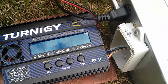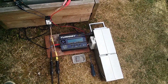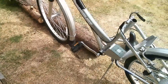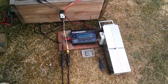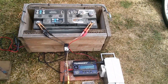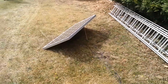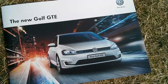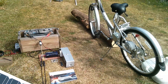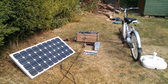So it's not quite as convenient to set up as it used to be, where you just had a mains charger pack that you plugged in and just charged it up easily. But this is now a genuinely solar-powered electric bicycle. The lithium pack is now almost a third the weight of the old lead-acid pack. And it now charges from this 12 volt lead-acid battery, which in turn is being charged from the 80 watt solar panel, which I've turned a bit to face the sun. So it's not quite the mode of electric transport that I would choose, but I think it's pretty good — electric bicycle, genuinely solar-powered now. I'm quite happy with the outcome of that project. Cheerio!